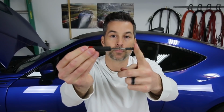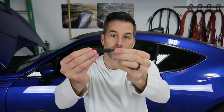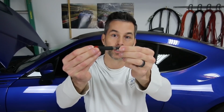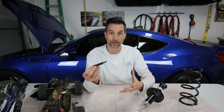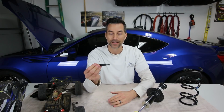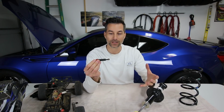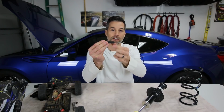Now, it's a little bit easier to demonstrate with the baby shock absorber here. Hopefully you guys can see that, but when I push it in, it's actually not even coming out right now. So this is an extreme. This wouldn't happen in a real car, but if we had maximum rebound damping capabilities, this shock shaft is gonna just creep out of here really, really slow, right? And again, versus very little rebound damping. See, it's confusing me even just doing this video. So again, if we have full soft rebound, very little rebound damping, when that shock goes to extend, boom, it's just gonna come right out.